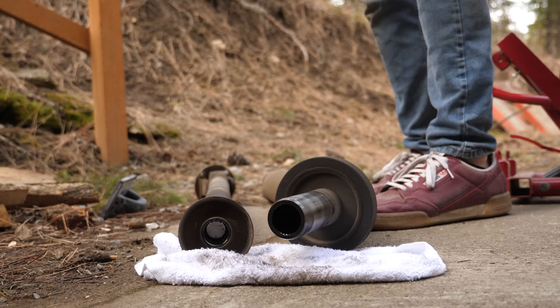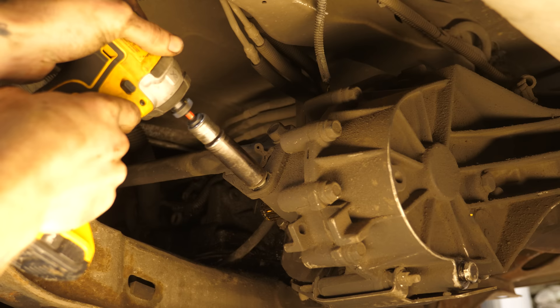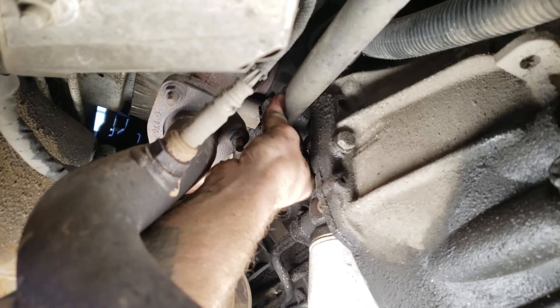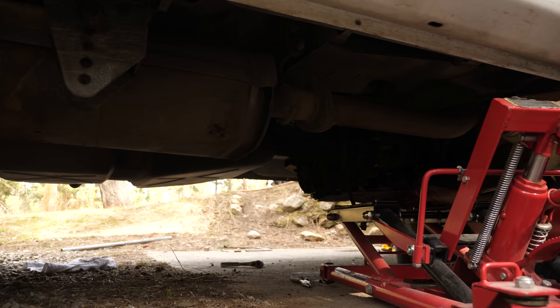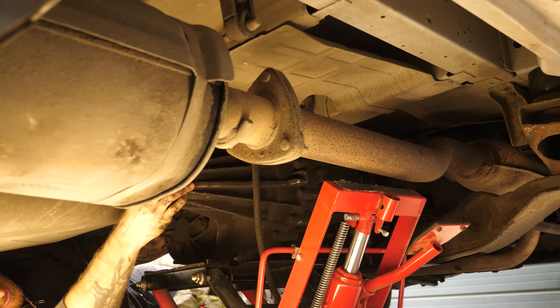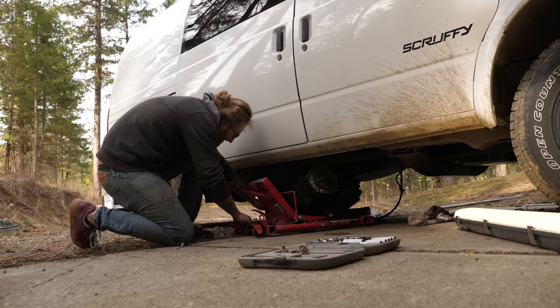The front shaft is similar — undo bolts from the front and slide the rear portion off. It's a little more stubborn because of an internal friction ring, so I ended up having to give it a few taps with a rubber mallet to drive it off. With the drive shafts off, we can remove the last piece before unbolting the transfer case itself. On the driver's side there's a crash bar support that won't bolt back up to our new transfer case. This is held on by two large bolts, and an impact gun makes easy work of these. The other end of this bar is connected to the side of the engine block by one large bolt, pretty easily accessed from the bottom now that the drive shaft is out of the way. We'll unplug all our electrical connections and begin to drop the case. Putting our jack back into place and raising it just high enough to touch the case without bearing weight, we can remove the remaining four of our five nuts. With a little wiggling and avoiding crushing any digits, this case will finally make its way off the van and onto the jack. Our project is now halfway done.